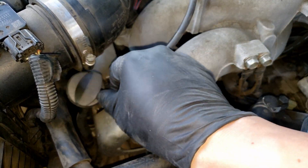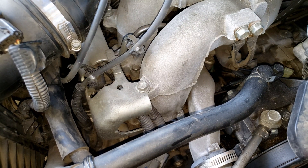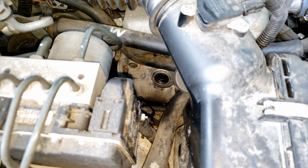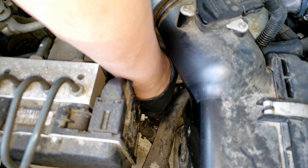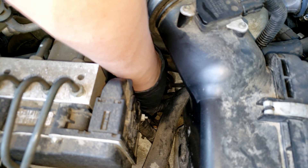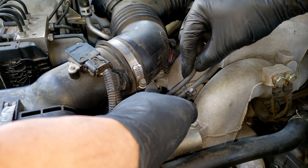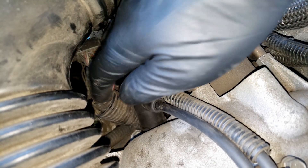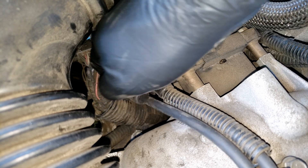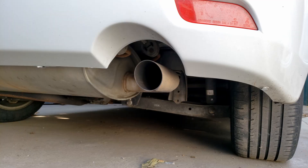Here you'll see the install of the replacement wire — I do go ahead and change all the wires, but if you'd like I'll show that full procedure in another video. Let me know in the comments if you're interested. I do already have a spark plug replacement video, and that'll be linked at the end of this video or in the description. When installing the wire on the spark plug, if you can't hear or feel an obvious click — which is hard to do on these — I always give it a slight pull to make sure it clicked and doesn't slide out. We then install the wire into the guides, followed by clicking it back onto the ignition coil, and finally start the car to see if it fixed our problem.